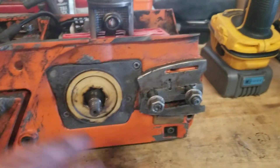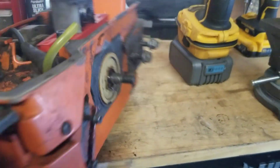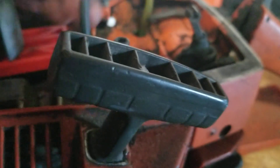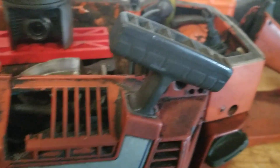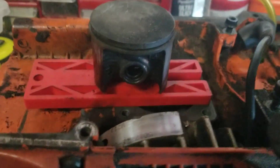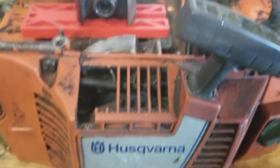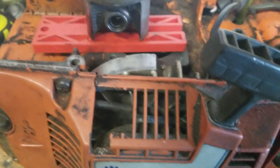All right, so that's the clutch side. Next I'm going to pull the flywheel side — see how tough that is. I also noticed that the coil wire's got a nick in it. The way it's not mounted right, how it's going in there, someone hit against the flywheel. And I noticed on this flywheel, it's been pretty well beat up. Somebody's done some backyard mechanic work on it. I'll have to see if it's true and it's not going to spin all loppy, lopsided because it's missing fins. But it should be okay — I'll try to reuse it.